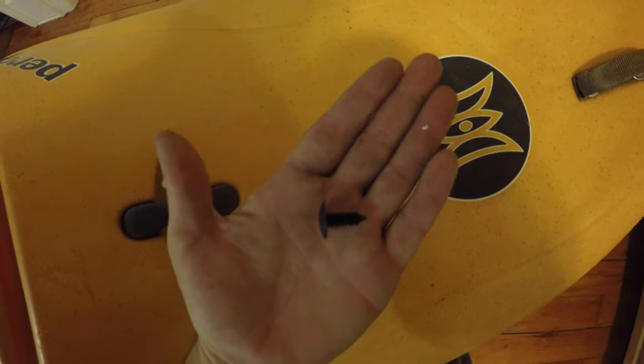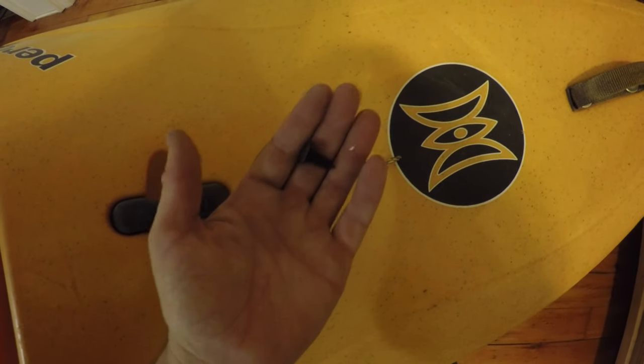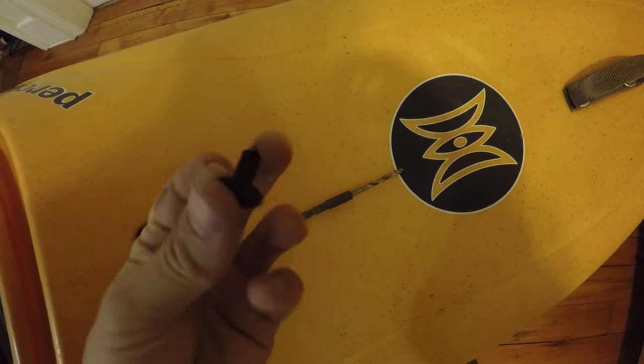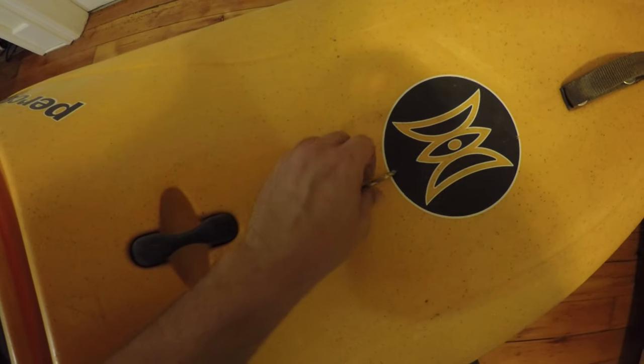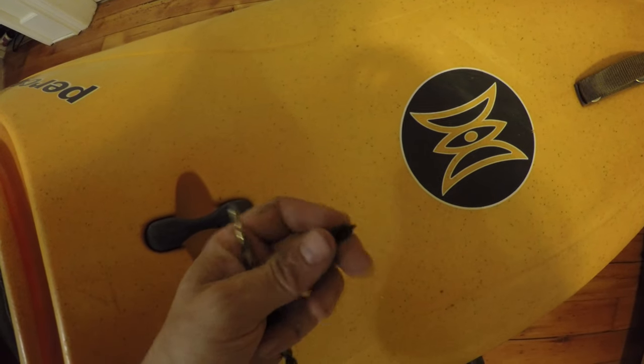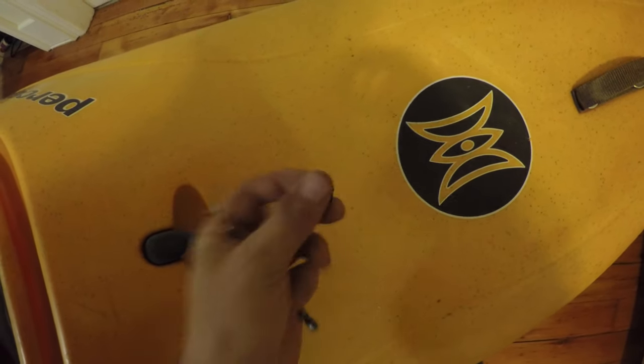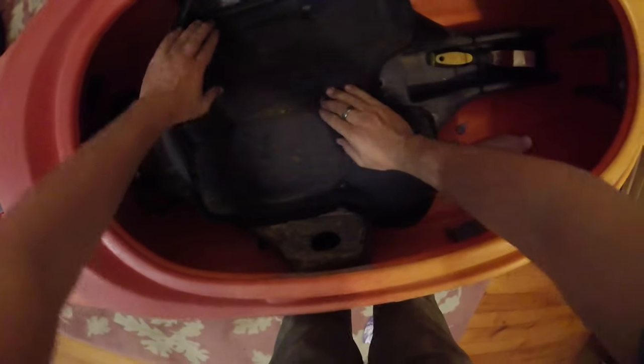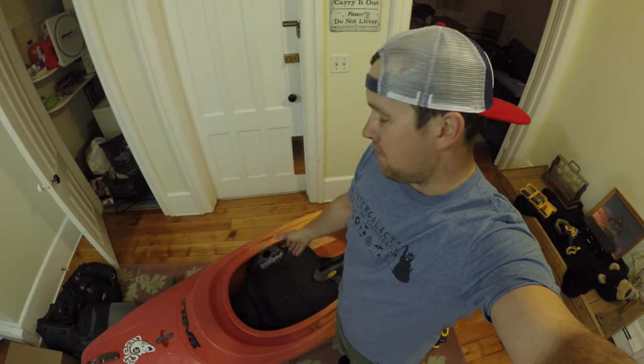These are the automotive clips. You hear them referred to as pine trees, things like that. Basically, the idea is that when it's inserted into a hole, all of these ridges flare out and trap the clip in place. The key is to use a bit that's close to that size, but still significantly smaller, so when you shove it in, it's not going to come back out. As long as you're careful and you just go through that first layer of plastic — very clean install, permanent, no glue, no mess. Enjoy.